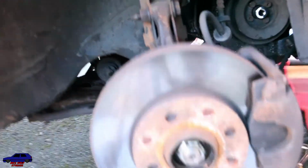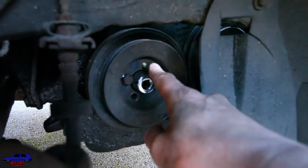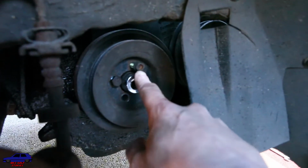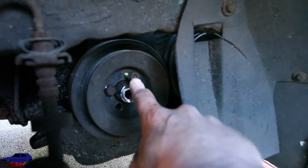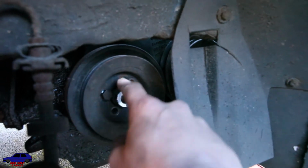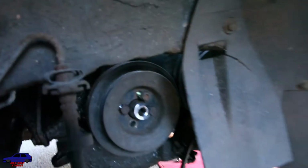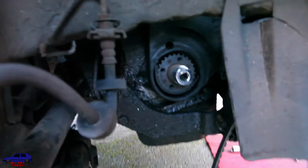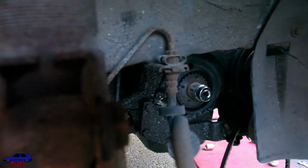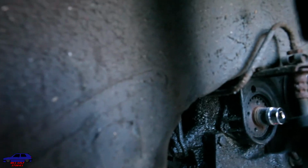Once you've got the belts off, you just need to loosen these, which is very easy according to Albie, with an H6 bolt. And what was that? Was that a 13mm socket? 13mm. And a 13mm socket, with a socket in the middle, just to make sure it doesn't turn. Here's to release the plastic cover. It's just that one there. Bolt there. And then these 10mm. Nice and easy. Lovely jubbly. Having lots of oil makes things easier sometimes.